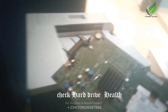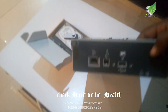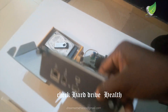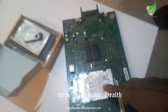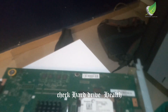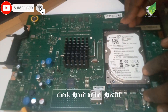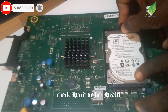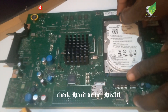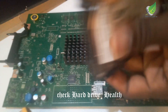The logic board is out. This is where the slots go into your peripherals, and this is the hard drive I was talking about. Now, is this hard drive bad, or is the firmware on it corrupt? The way to check this hard drive is to slave it to a computer and then check its health from a computer.